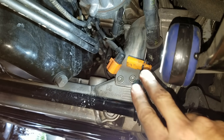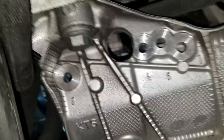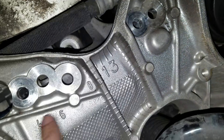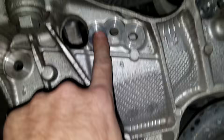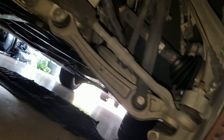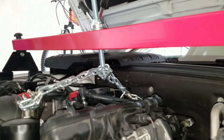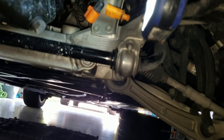We're on the driver's side and it's the same situation. You've got your two bolts here, this connector, and up in here I already took these bolts out — bolt up in there and bolts here. I took those out and I'm going to take off those two as well. I also already put tension on the engine support brace — I screwed that down a bit to lift the motor up a little. I'm not using the floor jack this time unless I need it.